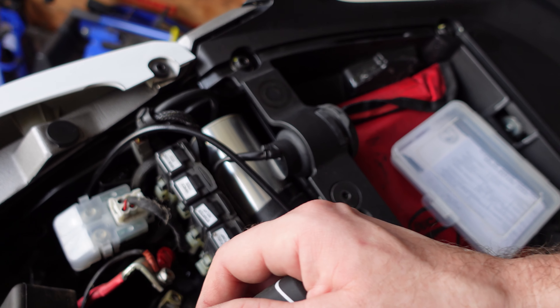The install was pretty easy. The two Phillips screws were easy to put in with the battery sitting up. Just lay the battery down, put your support bar back in with the 4mm hex key, and we're done. If you don't have one already, I'd highly recommend putting an SAE plug for a battery tender on the bike at this point — very easy while you have access to it. In my experience it doesn't self-discharge very quickly, so as long as you ride it once a week or so it's fine, but now is certainly a good time to add that.